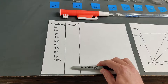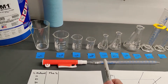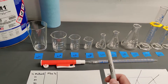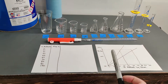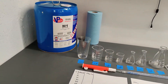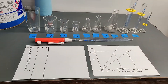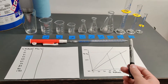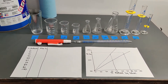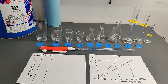I'm just going to write down the output of the flex fuel sensor as we go up in blend percentage. One caveat: I don't really plan to use anything more than 50% methanol. One of the biggest reasons is that for methanol, you need about two to two-and-a-half times the amount of fuel by volume over gasoline in a performance application, depending on whether it's naturally aspirated or turbocharged. So if you run straight methanol, you need a ton of extra fuel, fuel pump, and fuel system — it would get out of control fast. My target is just around 50% methanol to see if I can get it to output the same lambda values and get the car to work with that blend.